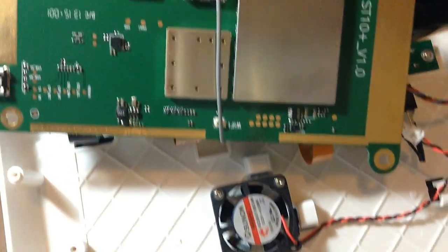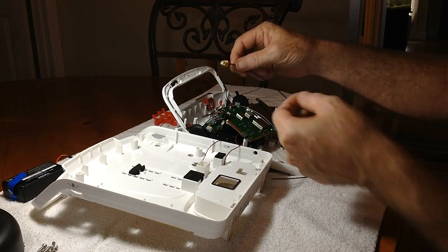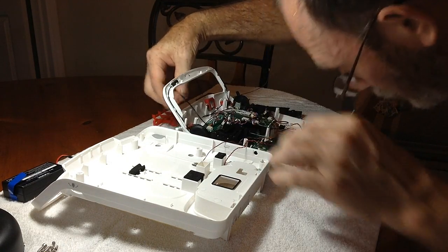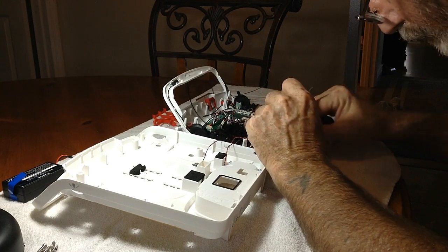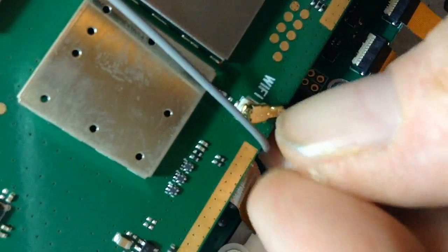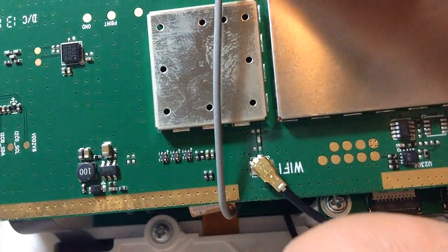Let's get a good look at what we've got going on here. Take your time and look things over so you're familiar with what you're looking at. You can see that little fan in there that everybody talks about hearing — it's just blowing on the Wi-Fi board, keeping things cool. So I'm going to insert this pigtail wire and feed that down underneath all the circuits. Make sure it's not anywhere your thumb controls are going to end up pinching it or causing restrictive movement. Then we're going to press that pigtail lead right back onto the Wi-Fi board where we took the previous one off — it's a nice little click, and it should be a very firm connection. It almost has a swivel effect.